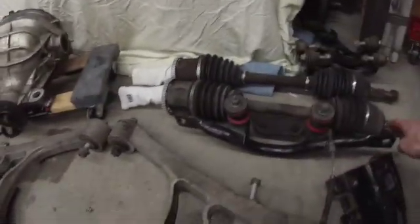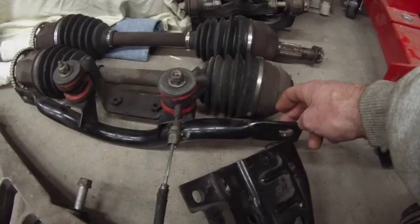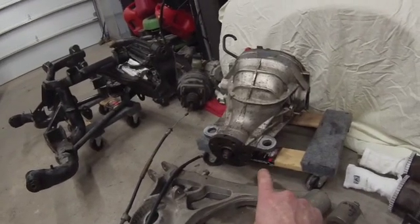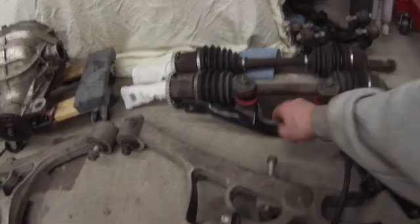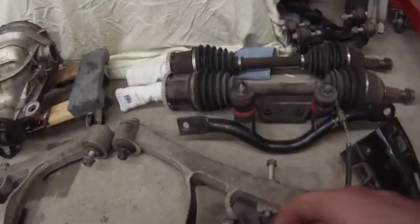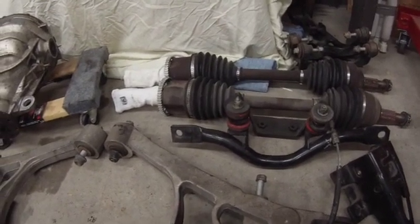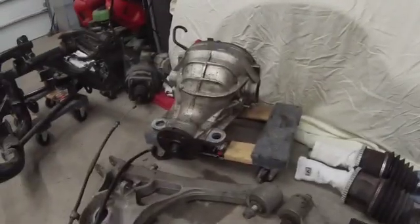And then, like I said, these lower control arm bolts go through this bracket that goes underneath the front edge of that differential carrier, that center pumpkin. Yeah, and it was just a little bit tricky. There's tons of washers and this extra little bracket that goes underneath that differential carrier. Like I said, it's all hanging in there. So once you undid something, then it seemed like something else was binding.